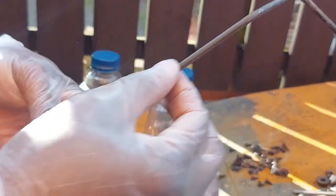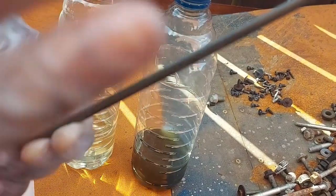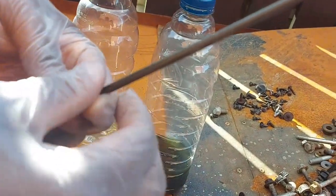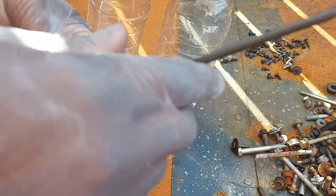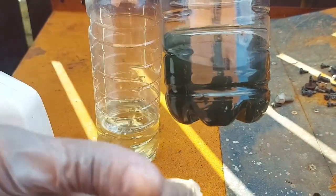On the outside, your brake pipe looks perfectly clean and nice — that's what you see on the outside. But the brake fluid inside is eating away at the material of the pipe. One day you put your foot on the brakes and this thing just bursts open from inside — this is where it becomes dangerous. Because if it comes to me as a technician for MOT, I'll clean this pipe on the outside, and as long as it looks clean I'm satisfied. But little did you know that inside it's rotten. We don't want brake fluid like this.